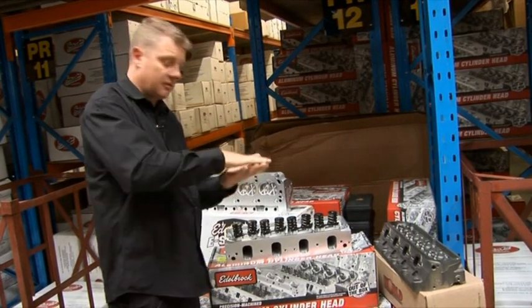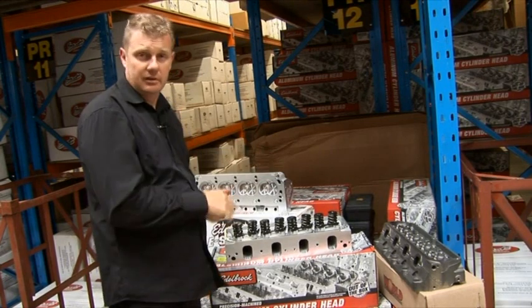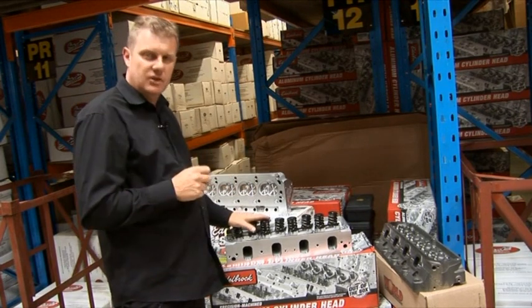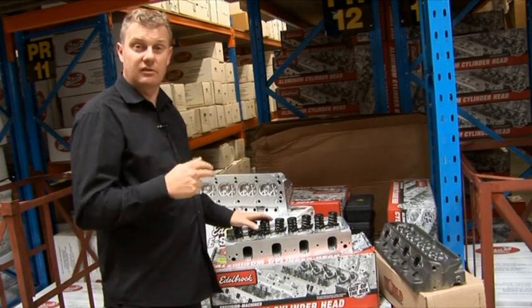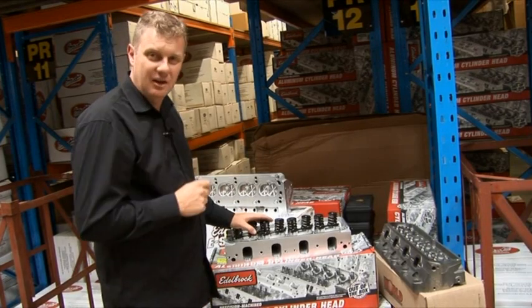As far across the top of that piston, exerting all of that heat energy pressure down on it, the better it's going to be also. An interesting thing I found over the years was you could always tell an efficient combustion chamber when you had to use less ignition timing to make the same amount of power — you knew it was working well.